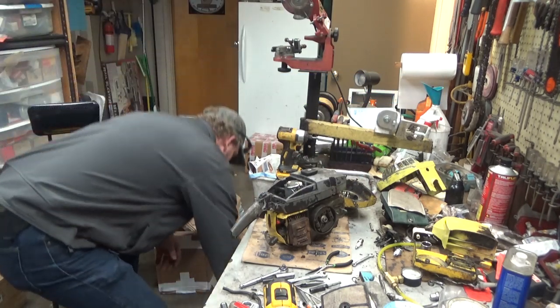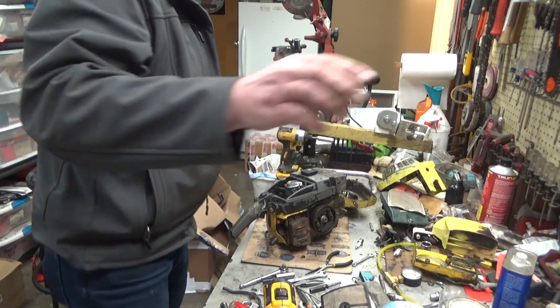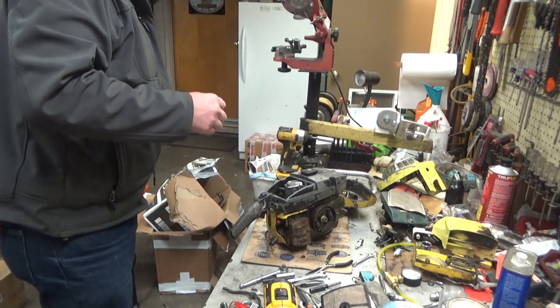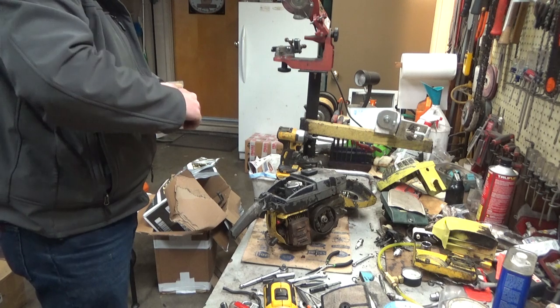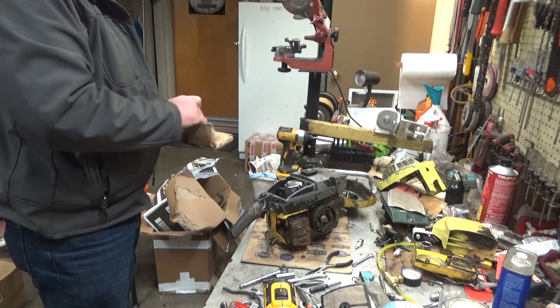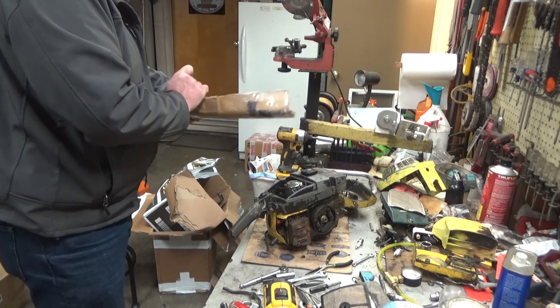But this may be less work than I thought in terms of money. Drilling that stud out of the cylinder is not going to be any kind of fun at all. But I'll grind it flat, center punch it, and I'll hope for the best there.